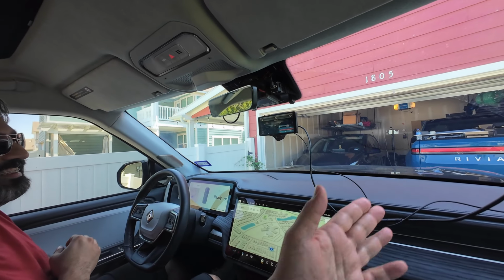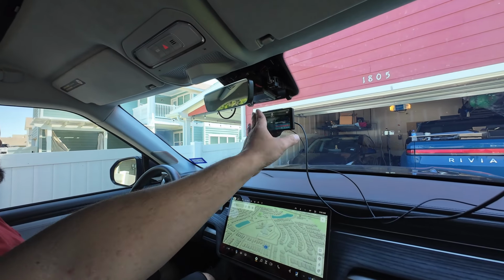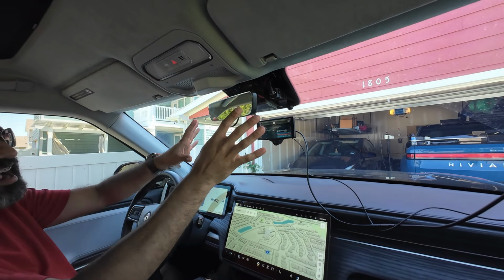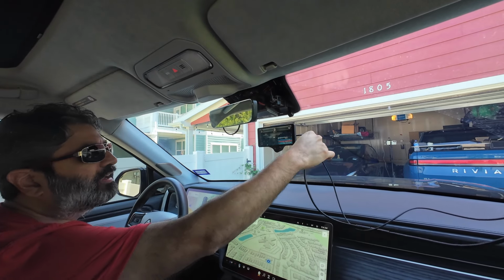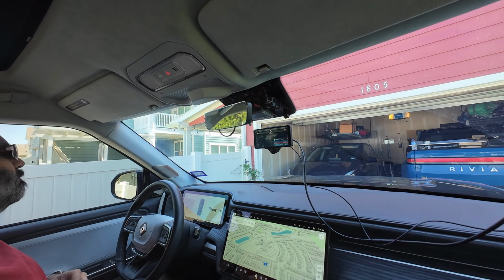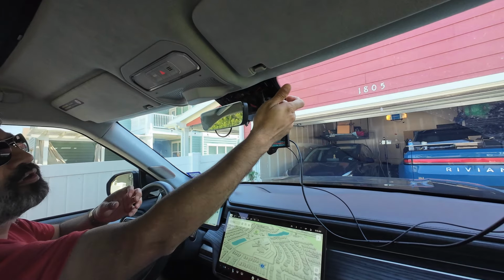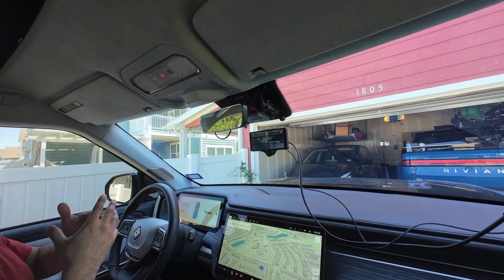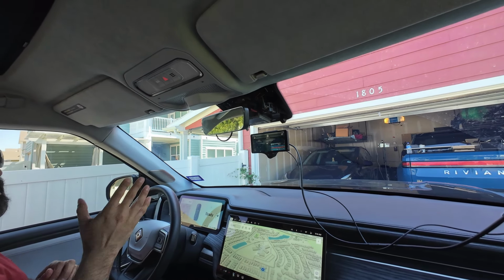All right, so let's do a little bit of cable cleanup, and then we'll send you on your way, because I don't think you want to put this back on, because you still have stuff you want to do in here. Yeah, I'll leave this off until we figure out exactly where I'm going to set the radar detector and the pigtail. But yeah, we can clean up the cable and route it up here. Yep. Maybe even zip tie if you have to. As I was mentioning, it depends where people will put the radar detector. They could always put a notch on the plastic trim to route the wire, and then just zip tie it. Once it's done, it looks very clean. Absolutely. Like it came from the manufacturer.